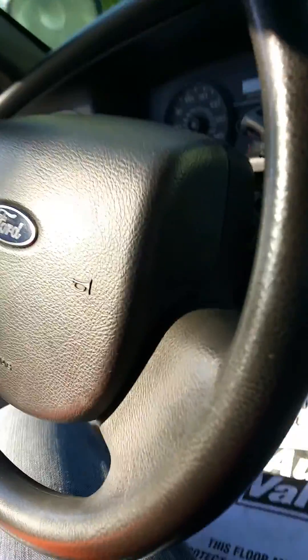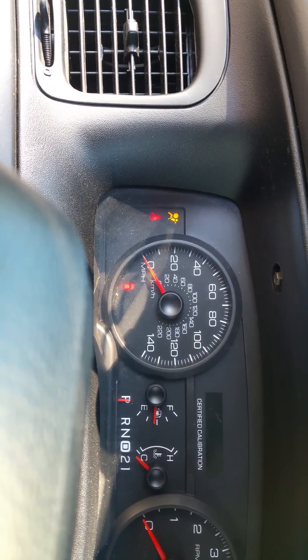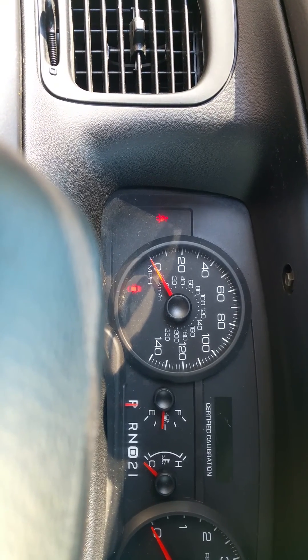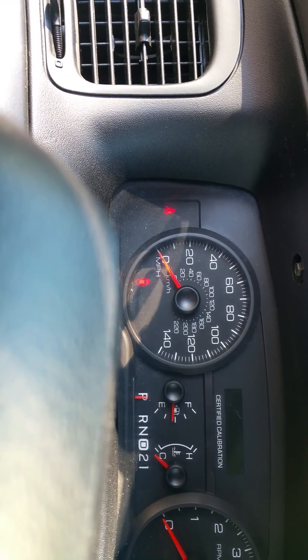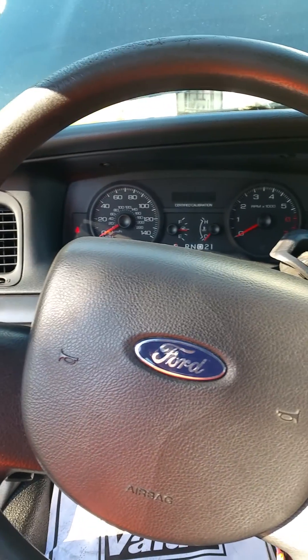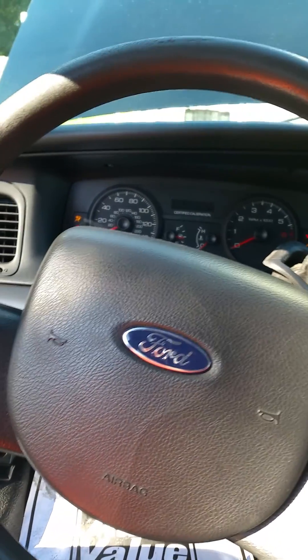Today's issue is I have a code on my dash. All my lights come on, and another issue is my mileage doesn't show sometimes — I can hit the dash and it'll come on and illuminate. My airbag light is blinking three pulses with a pause in between, then another three, and then it gives me a chime of five times. Looking online on forums, YouTube, and eBay, I found that code 33 means a seat belt pretensioner faulty circuit — a resistor or something is bad in it.